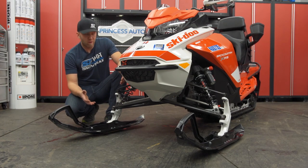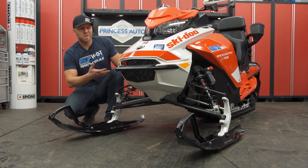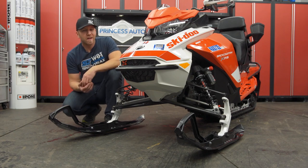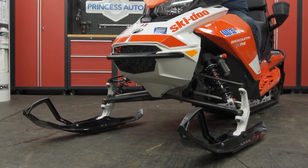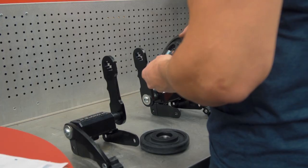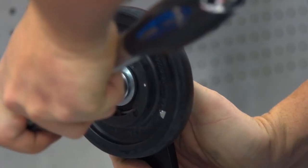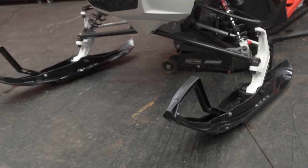While we're up front, something really important to note is that Skidoo snowmobiles are very rider-forward, and that translates into much higher ski pressure than other brands. While rider-forward does have its benefits, there can be drawbacks as well. When you're driving into a trailer, paved gas station, lunch stop, or hotel parking lot, it can cause a lot of trouble. When the front end bites so hard, the track just spins.